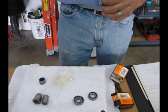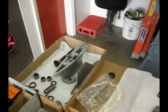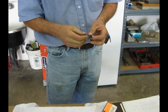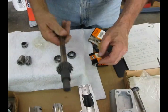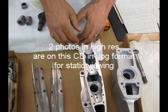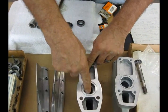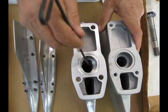If you notice, I don't have any thrust washers for this unit — the reason is I pirated them all building my lower units. They have just an acid etching. I've got the FAG part number and I'll give that when I send this stuff over. Ideally, we're going to put oil rifles — I'm going to send a good drawing. We remachine this top unit with an oil rifle up and a big oil return. Notice how large that oil return is.